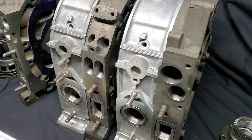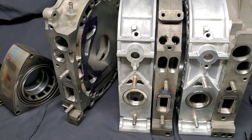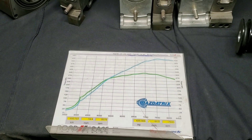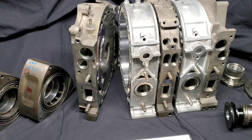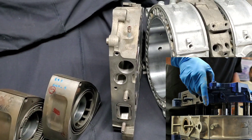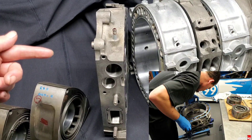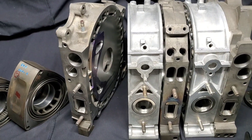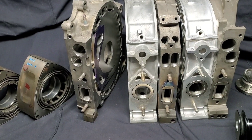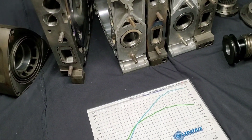With the Renesis, there will be more steps, especially if you're aiming towards boost. I recommend studying these blocks. When we built the motor at Mazda Trix — which is the graph we're talking about right here — we built that motor with boost in mind. The motor was prepped very similarly to this, but with one of the biggest differences being it was a fully studded block. Half-inch studs through every one of those tension bolt holes, precisely fit. Basically everything else was prepped just like this: a street port, RX-8 rotors, side cut, two millimeter RX-7 seals.